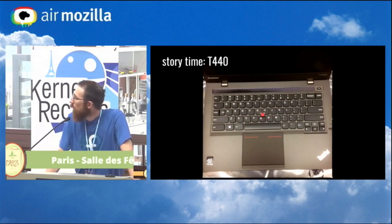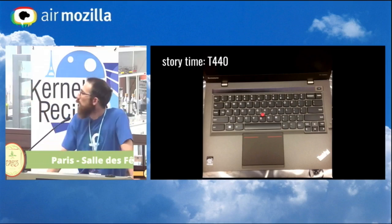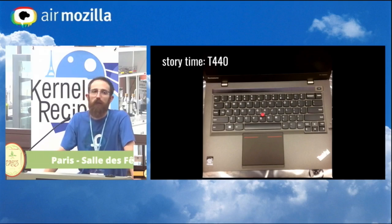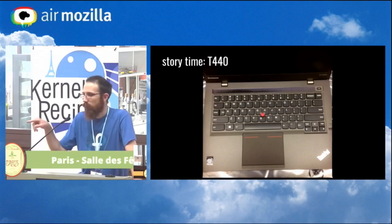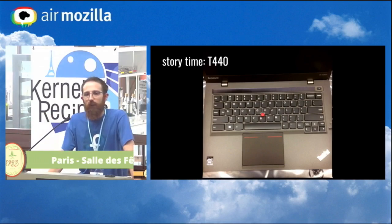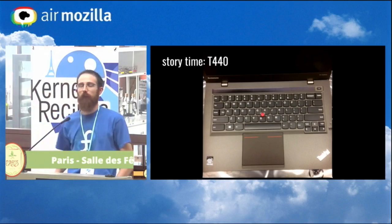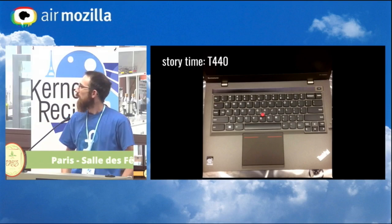And the thing is, when you want to have software buttons to assign the three top buttons to the track stick, you need to have accurate coordinates on the touchpad. And of course, they made all of the QA. I mean, that's my interpretation, that's not actual from Synaptics, but what I get is that they made all the QA under Windows, under SMBus, under that driver, and under PS2, the actual coordinates were offset by a lot. So when we forced and implemented the thing, basically you would declare, okay, so the top 5% will be buttons, and you got something like half of your touchpad which are the buttons, and you have just a few touchpad portions. So that was a pain.